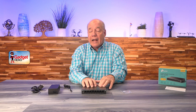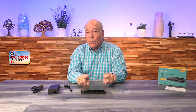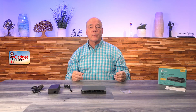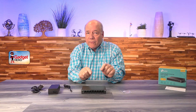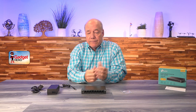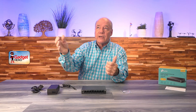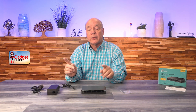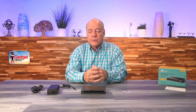The basic functionality: all eight ports are active, all are 1 gigabit Ethernet — fast, compatible with most home networks — and all are PoE enabled. That's important because some switches on the market with eight ports only provide power to six or four of those ports. This unit provides a total of 65 watts of power to all eight peripherals, and individually up to 30 watts per port. It can send power up to 820 feet away — specifications you'll want to compare with other switches, because you never know what you're going to plug in.